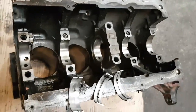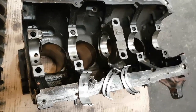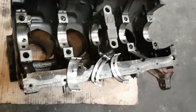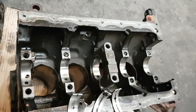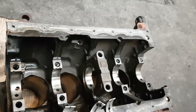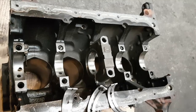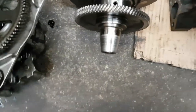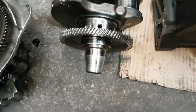So that leaves us with a problem — we need to get an engine block suitable for this engine, and the crankshaft will need to be reground with bearings to suit. The oil pump gear will need what we call a modified oil pump — my own personal oil pump modification. It's not just a matter of replacing the oil pump; think about what you're doing — you're putting a new oil pump onto a crankshaft gear which already has a worn track down the middle, plus the crankshaft is continually wearing.